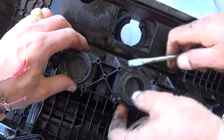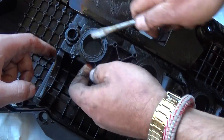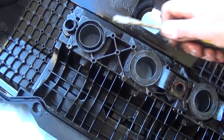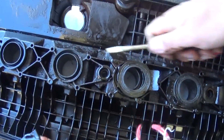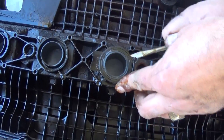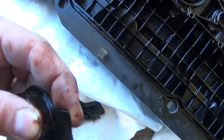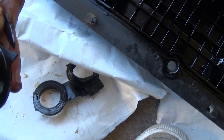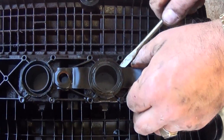Now you need to go and remove the spark plug seals right here — the holes for the spark plugs. Those are the ones that burn terribly bad — you can see that thing is cracking. You need to go all the way and remove all six of them. Be careful not to damage any parts. That's plastic now — it's supposed to be rubber, but it's baked from all the temperature and being a high mileage car.